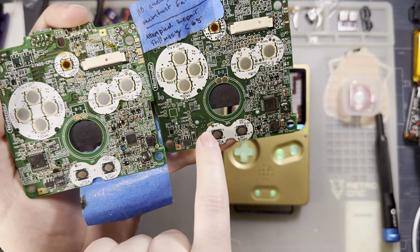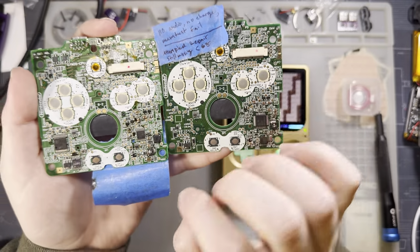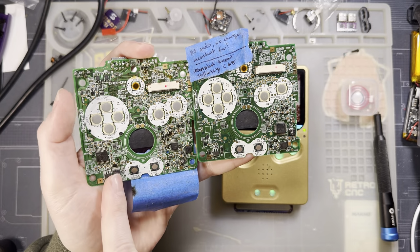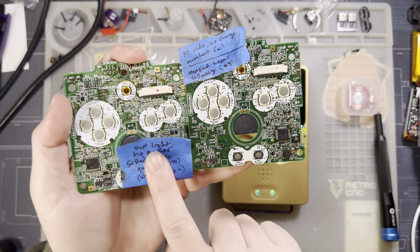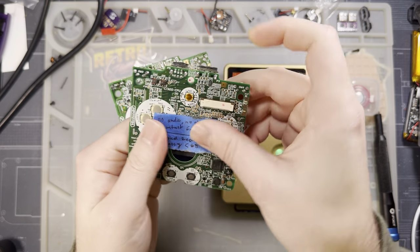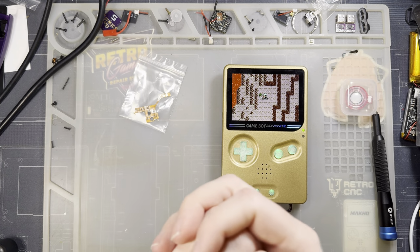But you just have to solder it, I believe, to this via right here. So you just got to run a little jumper wire, and then it works out the same. So for ease of install, this is the preferred model, but it works with both. Inside this console, I'm pretty sure I have a three chip model, so that's what we're going to be using. But I just wanted to show that off so that you guys are aware in case you decide to embark on this on your own and your console does not look the exact same as mine does. So that being said, let's begin.